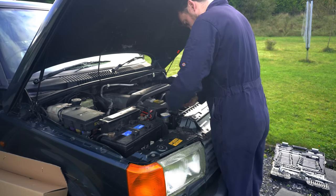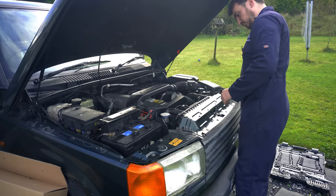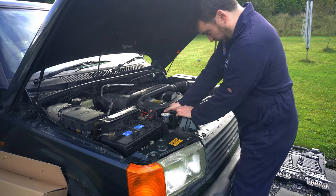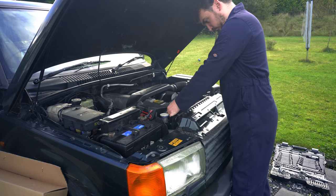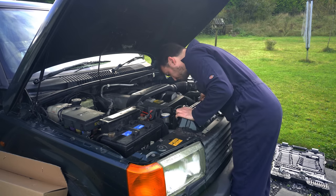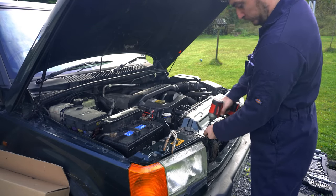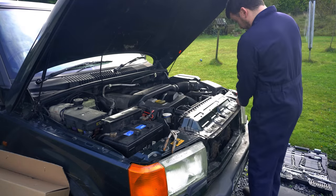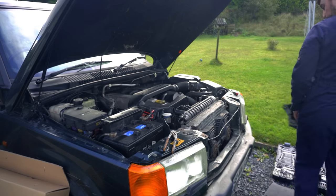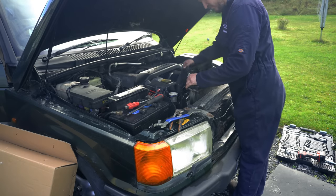The first task is to get these radiator hoses off. On the P38 diesel, both the top and bottom hoses go to the top of the radiator. And once that's done, the removable slam panel can be removed with the help of the little impact gun. After removing the viscous fan, we can slide the cowl, fan, and radiator up out of their respective homes.